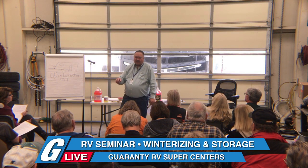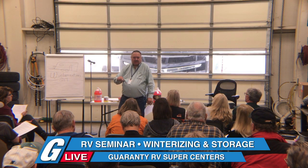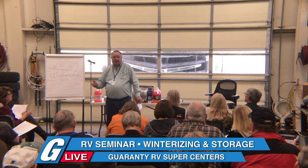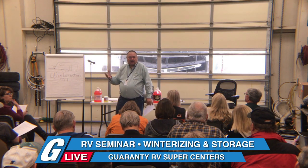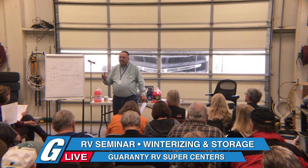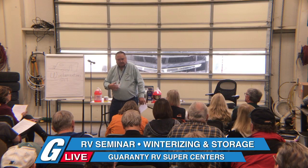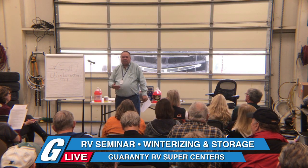If you take Happy Camper and a little water, sprinkle it on a nice wooden coffee table, come back a month later, you'll have a hole in your coffee table because that's beta cellulose. And this enzyme eats beta cellulose. And you say, well, why do I care about my coffee table? You don't. What you care about is the toilet tissue that you use is made out of beta cellulose, wood fiber. So you want a toilet chemical that will digest the toilet paper because it's like a mat and it builds up in the bottom of your tank if you don't use chemicals. So you need some of that toilet chemical and you need to let it sit, but not when you're winterizing. Do that in the spring.